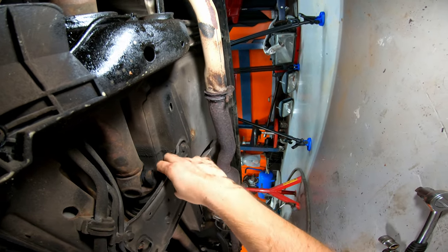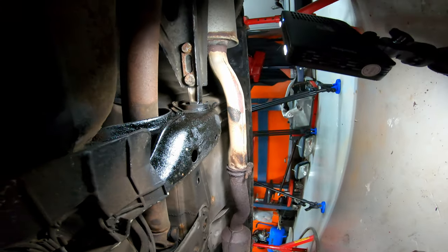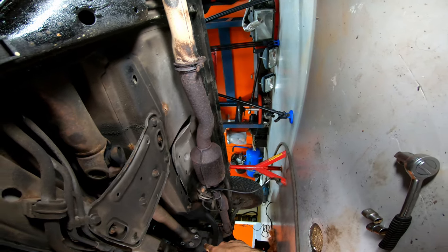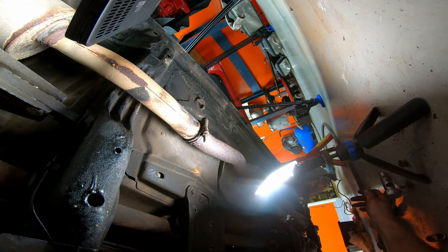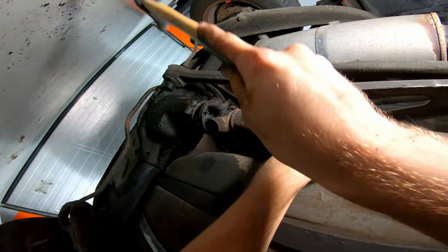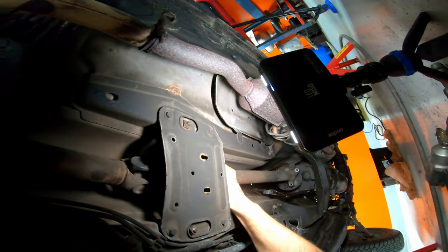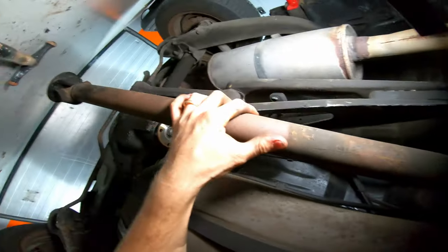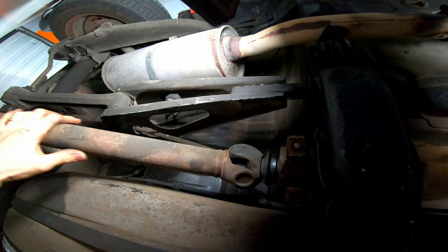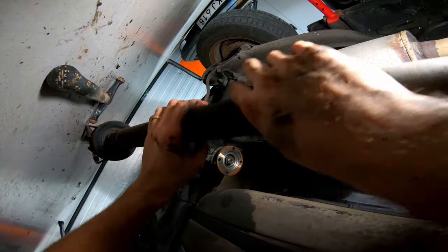Point number two with the drive shaft is getting — there's a bearing right here that keeps the drive shaft in check. So we're going to unbolt the bearing and then pull the whole drive shaft backwards to get it off the car, because it rides on a pin up front, so you can't pull it downwards — you've got to pull it back. Oh, I just had the biggest muscle cramp in my arm right now, so I've got to wait a little bit. I don't want to lie here with the drive shaft on my body with a cramp in my arm. See? It kind of rides on a pin. It's very important not to split this.